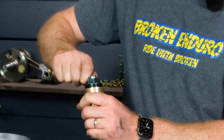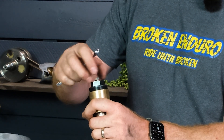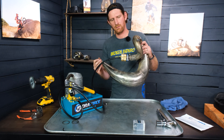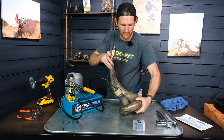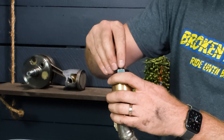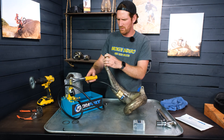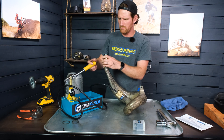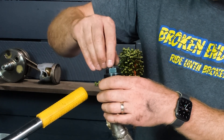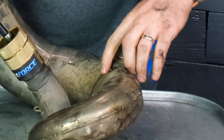Release the bleed screw to get as much of that air up to the top as possible. There's also a copper washer on here that you don't want to lose — that seals it. Then I'm going to pump this a few times. I've already added water to the trough. Got water coming out the end, going to cap it. There's some minor seepage, hopefully not so bad that I can't get it to pop out the dent.